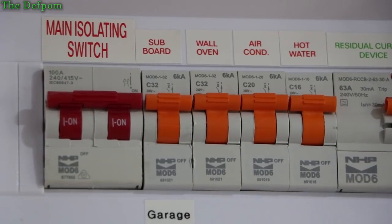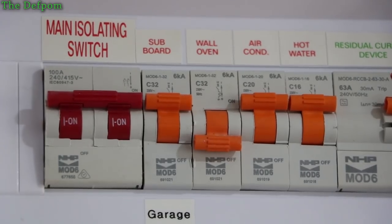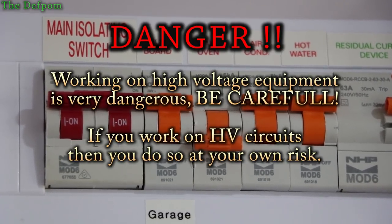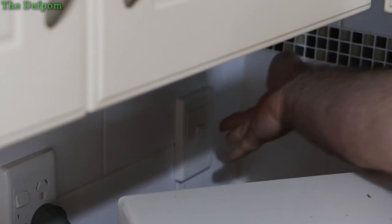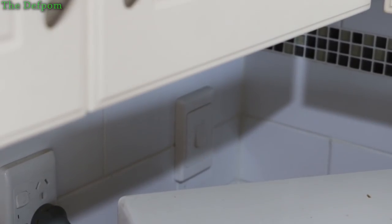The very first thing we've got to do is to make sure it's safe — make sure that the oven has power turned off to it, and then obviously verify that on the oven itself. There's also a wall switch by the oven which I'm also going to turn off, so therefore I've got two levels of isolation between me and the power supply at least, and then I'll verify on the oven. Just to be absolutely sure I've definitely got the right supply lines — you never quite know.